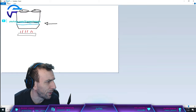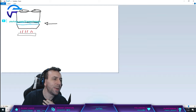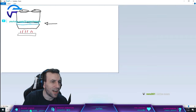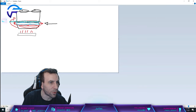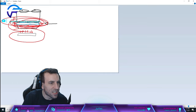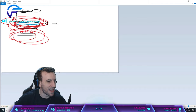The only cooling it actually gets is this bottom plate here when the TEC is turned off. So direct die, or using liquid metal - maybe liquid metal would make a difference if there was a transfer problem, but there isn't really. If you go direct die it wouldn't do anything, because you're still limited by the cooling capacity of the ceramic. The direct die would still just transfer all the heat into this bottom layer, and it wouldn't actually transfer anything faster. It's all bottlenecked by this piece of ceramic. Whatever cooling capacity this ceramic has is all you're getting - doing things to the IHS or the die wouldn't yield anything. It's not the lowest hanging fruit.